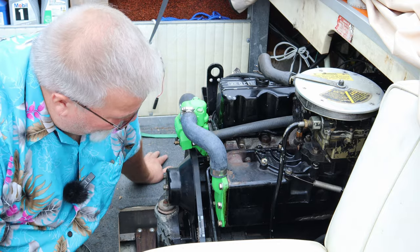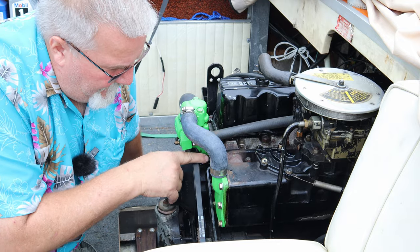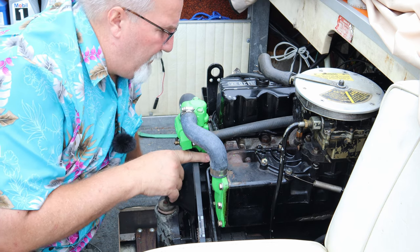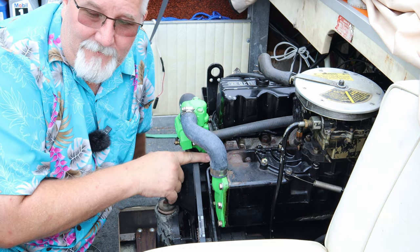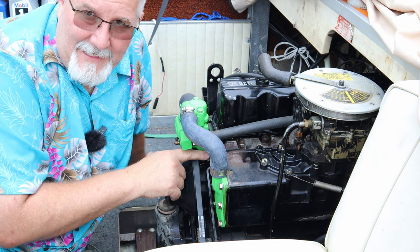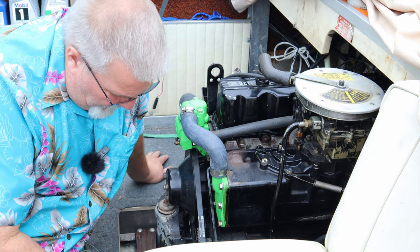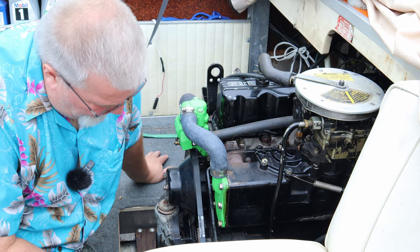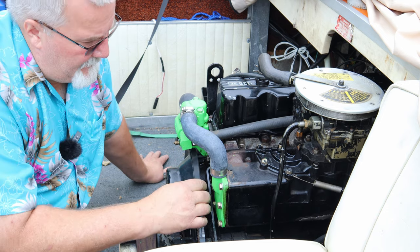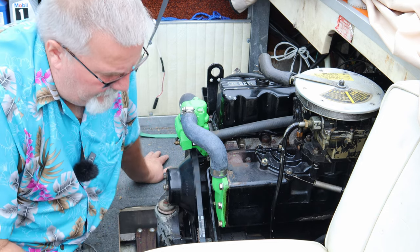I'm like, no. Come to find out, this bolt that's on the alternator bracket here is a through hole to the water jacket. And when I pulled it and put it back together, I didn't notice that. And she leaks water, slings water everywhere. That's the only leak I got, the only problem I got. So I've got to take, looks like, a few things apart.